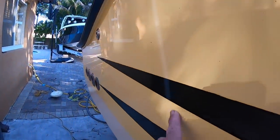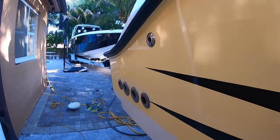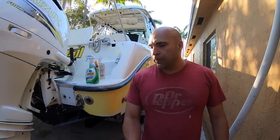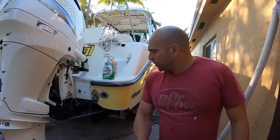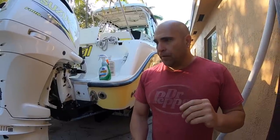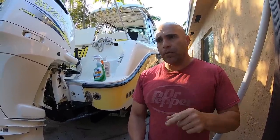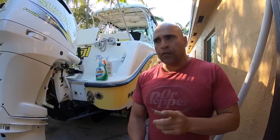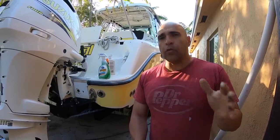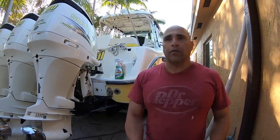At the same time, I'm going to buff it — you can see how the black is coming out shiny. It's not that hard. I thought it would be harder. I did that section in about two hours. For sandpaper, I'm using 80 grit, then jumping to 120, then 320, then 400, then 800.